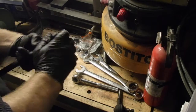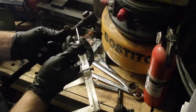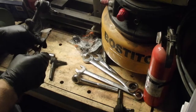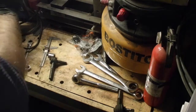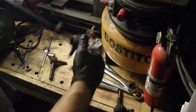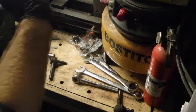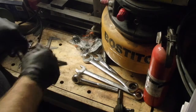Some of these will be a bit sticky if you look in there - a lot of grease. So let's count the threads first: one, two, three, four, five, six, seven. Let's match the distance. That's a pretty torn up ball joint cap - one reason why I'm replacing them.